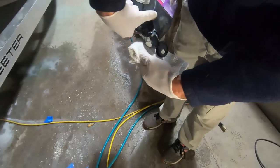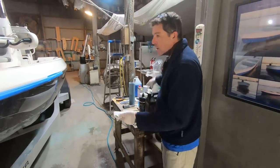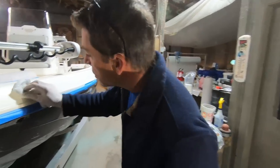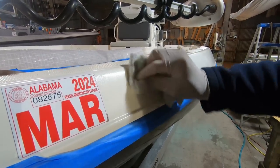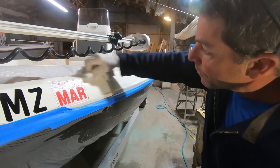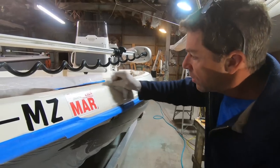We went down so fine you don't really need anything terribly coarse. If you'd only gone to about 1000 or 1200 you may want to use something like the Super Cut — that's going to be a heavier duty compound. One advantage to doing it this way is you're not going to risk slinging compound everywhere. So even for a guy like me there may be times when you have a big machine but it's overkill. We're just going to apply that in a nice circular motion — you can actually hear it working. Nice firm pressure, circular motion, going round and round back and forth.